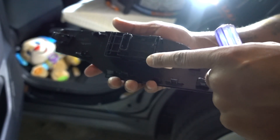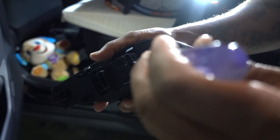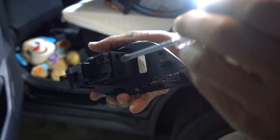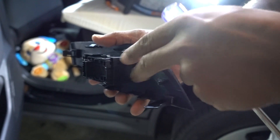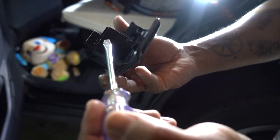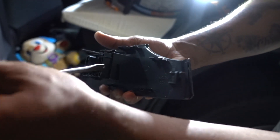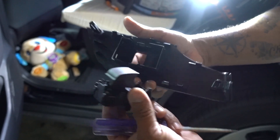The easiest way to remove these controls on the other doors: I put my screwdriver inside here, I lift it a little bit — the plastic — I push it up so I can release it from the two little hooks. Same thing on the front part — it has a little hook in there. I just put my screwdriver inside and release it. Super easy.